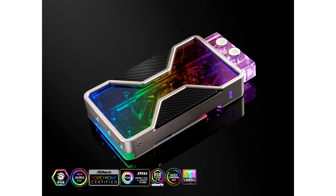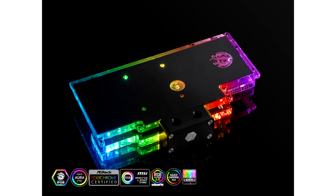The X10 Backplate for Asus ROG Strix GeForce RTX 3090 is an interesting product. It's a backplate that features a small water block that pulls heat from the GDDR6X memory chips located at the reverse side of the PCB, as well as heat from right behind the GPU. A distributor is included, so you can share coolant with your main water block that's on the reverse side of the PCB.